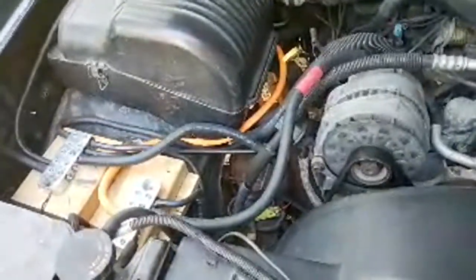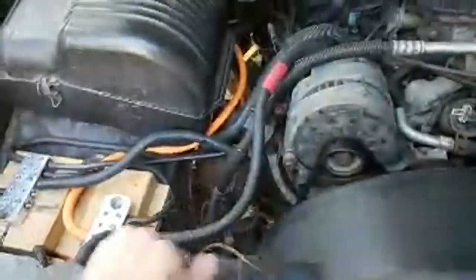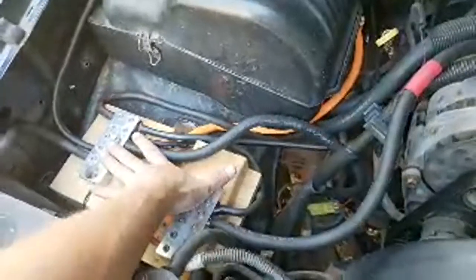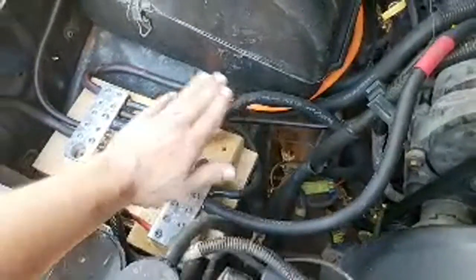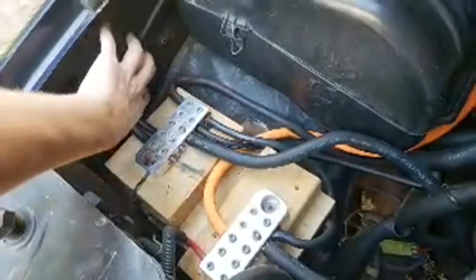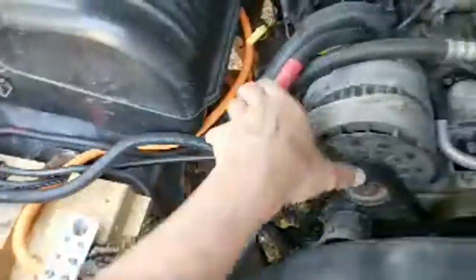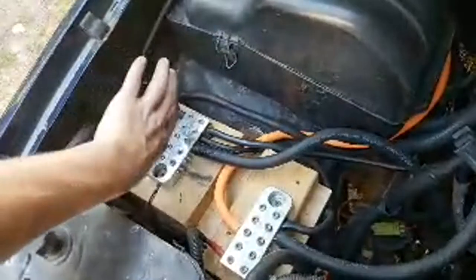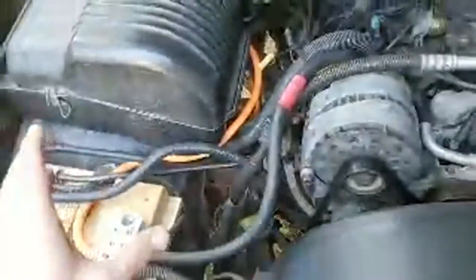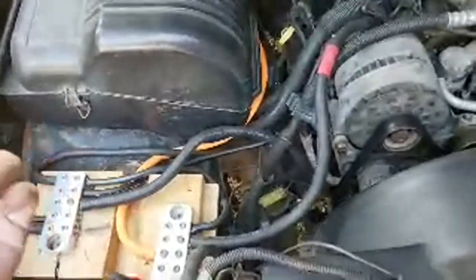Another question people had was about cooling for the alternator. One thing I've seen people do after getting rid of their front battery: put a cover over the battery area, cut a hole in the fender well, put a PVC tube in there, and then direct an Atwood fan pointed directly at the alternator. That draws cool air in from outside your fender well straight across your alternator and actually helps keep it cooler.